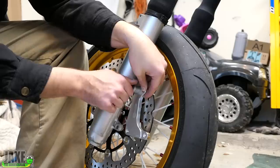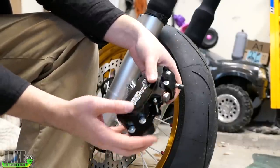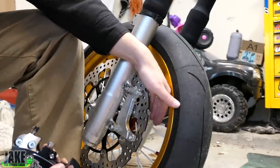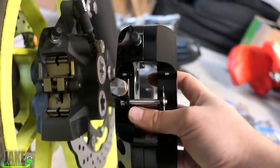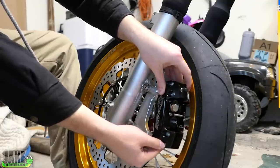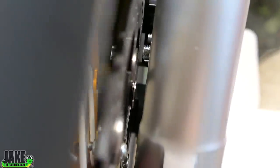Go with the CoreMoto ones because they do have that warranty and UV protection — not all of them have those. Apparently they're DOT approved. We're going to put this in without the pads first. To take this on and off, you'll probably typically have to pull the pads out. Because this is such a big rotor and we've gone to a 17-inch rim with the spoked wheel back here, this is all very tight. This is why it would be really hard to just grab any random four-piston caliper and shove it on a supermoto — they even have to taper the ends here to make it easier to fit in. Just spin the wheel and make sure the ends of these bolts are coming nowhere close to the rotor. That means we have the good hardware in here.